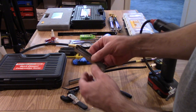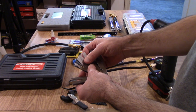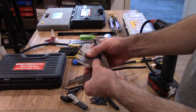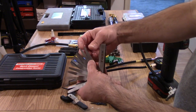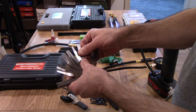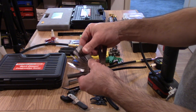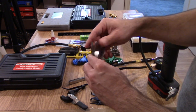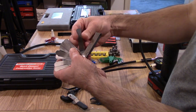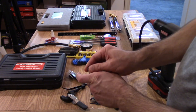If you are riding four-strokes, you're going to need a good feeler gauge set for when you need to check valve clearance. I got this one from Rocky Mountain — it's specific for dirt bikes or motorcycles, and the feeler gauge strips are narrow at the end. On a dirt bike, the areas you need to get the feeler gauge into are often pretty small and cramped, so these are helpful. Standard automotive feeler gauge sets are a standard width all the way to the end, making them hard to get into those confined spaces.